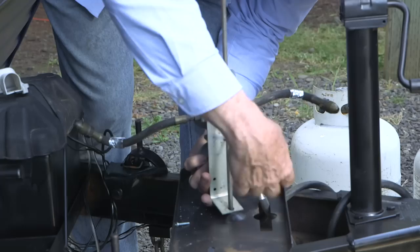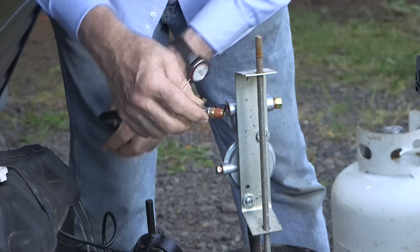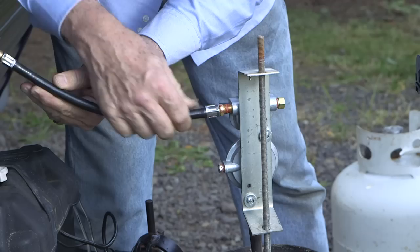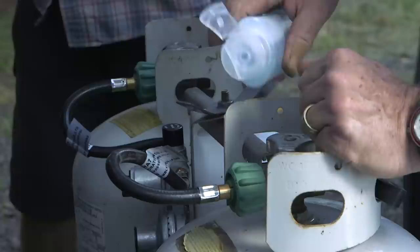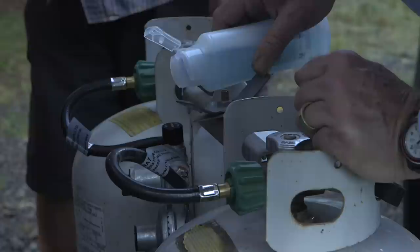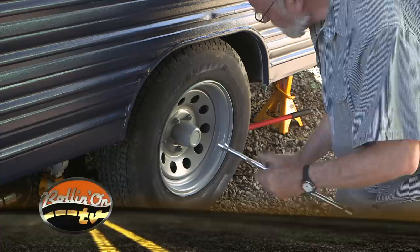We removed the cylinders to clear up access to the plumbing parts. The old regulator came off easily, but we needed washers to make the old screws fit the new model due to slightly shallower mounting holes. After removing the optional adapter fittings, the new Acme hand wheel equipped hoses screw into the new regulator. The red substance is thread sealer factory pre-applied to the fittings. After assembling the parts, we cracked open the tank valve and checked for leaks with a soapy water solution. We only found one fitting that needed to be tighter. This completed the propane supply part of our once-over.